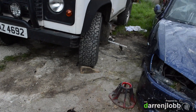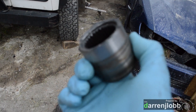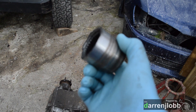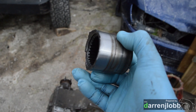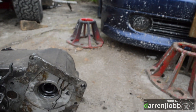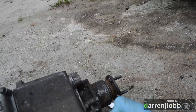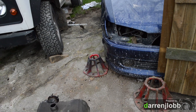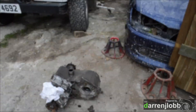She's out now. You can see she's sheared on the old input gear — right there, that's where she's welded by the looks of things. The other half is still in there, so I'll peel that out and have a good look at it. I also need to peel out the speedo drive as well, because funny enough that's sheared as well, just before she let go.